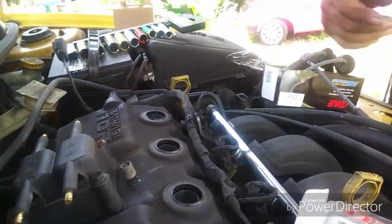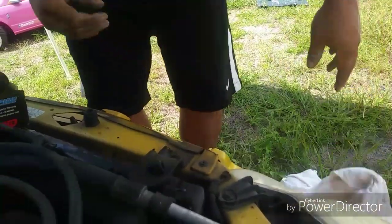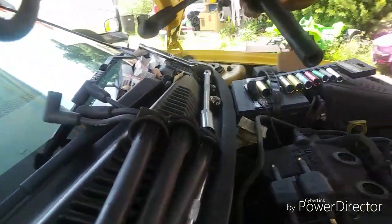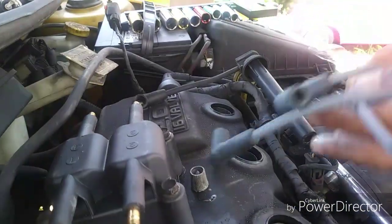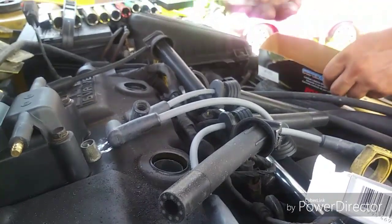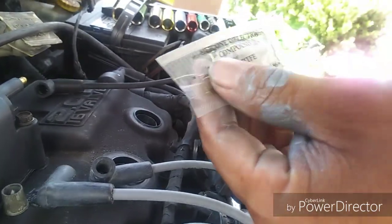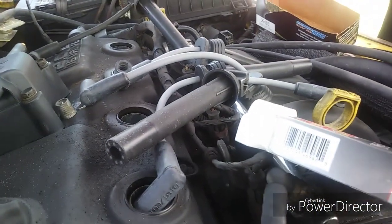Now I'm cleaning up my hands because I'm grabbing the spark plug wires. We're going to do number four first — that's in the back. I'll lay out the new wires. Make sure it comes with some dielectric compound — it's good stuff so it doesn't make your contacts seize up when you try to remove them next time. Squeeze a little bit out and get ready.